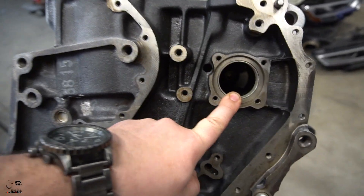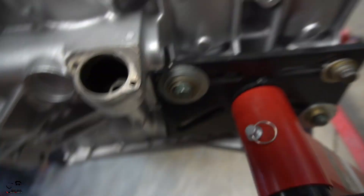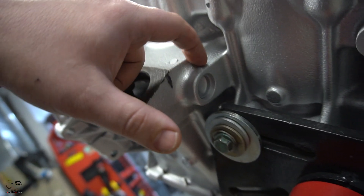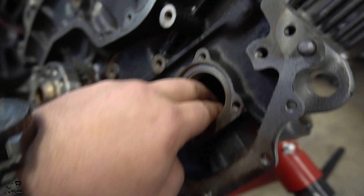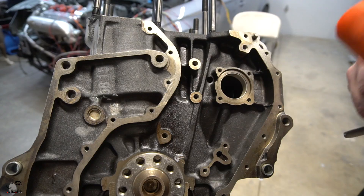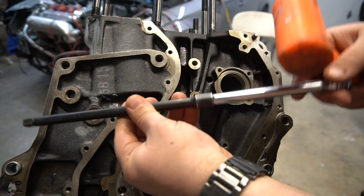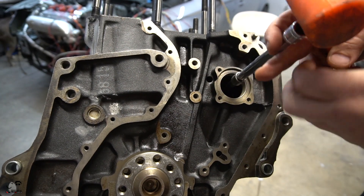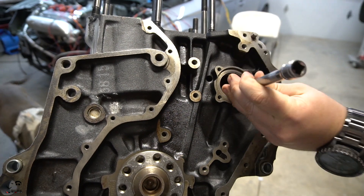A $20–$30 bearing kit is something you might skip out on or not realize you need, so we're going to go over it. There's a front opening towards the back, and that's going to pop off the cap. There's a smaller bearing inside and the large one here that we're going to pop out and remove. I'm going to first start by taking these professionally calibrated two extensions — three-eighths — and I ended up just taking it all the way down the center, putting it on that center cap, and then just a couple taps.